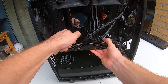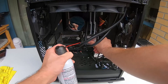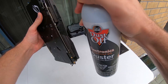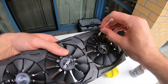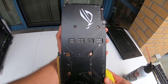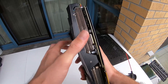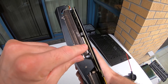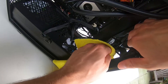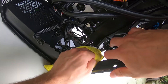My GPU could use a little extra cleaning so I'm going to take it out. If you want to do a deep clean, you can remove everything, even the motherboard. Set them aside after blowing out most of the dust, then go over the entire chassis with a microfiber cloth, grab a bottle of your favorite cleaner, and wipe it down. Once it's dry, reassemble everything and you should be good. In my case things weren't too bad, so I only removed the GPU. You can actually see here that the thermal pads have separated slightly from the PCB — probably from sagging — not a good thing. Give some loving attention to your fans: if you see any buildups of dust and grime in the fins, take a cloth and wipe them off. The cotton swabs will be your buddy for reaching those tight spots.